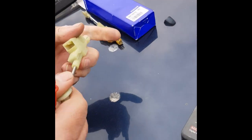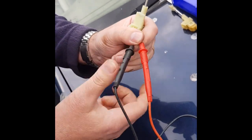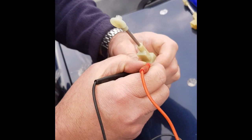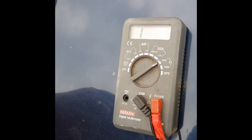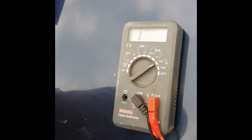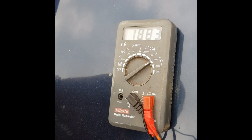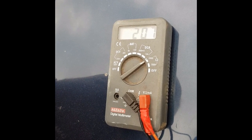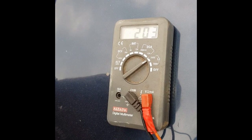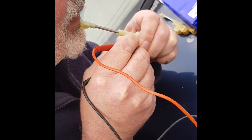This is the new one I'm going to test now. I've tested this already. The new one has a range of zero — quite fiddly to get at. That's gone out of range because I'm in the 2,000 ohm range. If I press this down slightly, it'll start to come back in range, and it goes down to 200 ohms — 207, 204, 205 ohms. That's as the pedal is pressed continuously. As it comes back out, it climbs back up to about 3K.